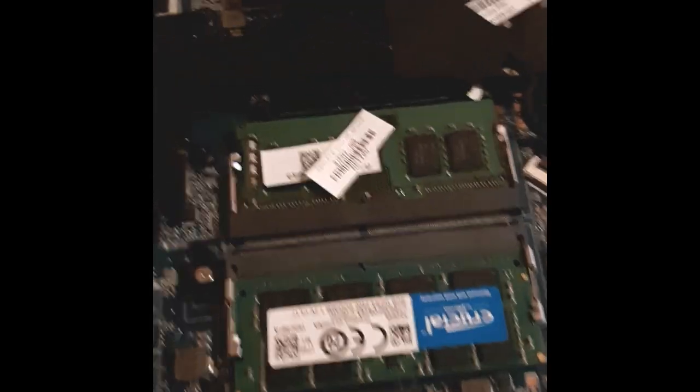Off comes the cover and I think we'll try to put the water block right here in the center of the CPU and GPU. It looks like the heat pipes run over this point. It really does look like this laptop's designed for this — the zip ties seem to fit right under the heat pipe. So let's go with a well-placed zip tie and some Arctic Silver.